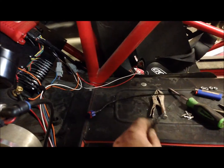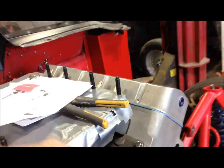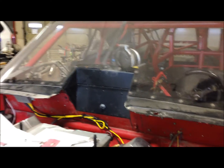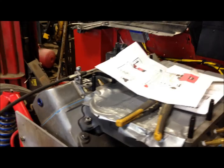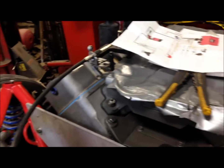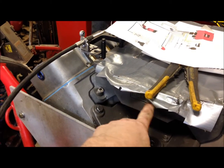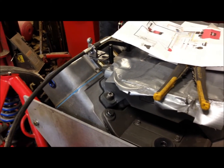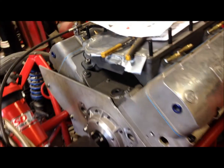This is the main cable here for the logger — it plugs into the logger, and then the logger will plug into the grid. I've also got a burst panel coming for the intake manifold — it's going to go right in here. I just got the cage kit and didn't get any of the burst plates or the panel that fits the manifold, so I've got that coming. I've also got a starter button coming. Once I get that burst panel, I'll take the manifold off and the machine shop can hog that out — there's got to be an opening to let pressure out. If there's ever a backfire, we want to make sure we don't split that manifold in half. It's also required by NHRA and IHRA to have it.